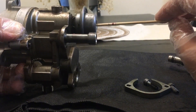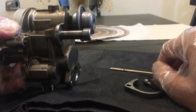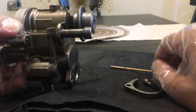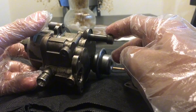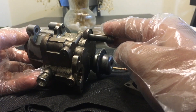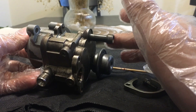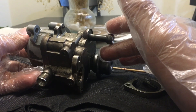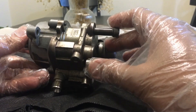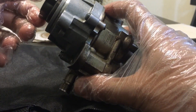So the diaphragm should measure around 19 millimeters after adjustment. I hope this measuring tool is handy for you, and I hope you don't get scammed regarding the high-pressure fuel pump. One more thing: you can buy refurbished high-pressure fuel pumps on the market, but be aware — the main issue is that they tend to fail again.